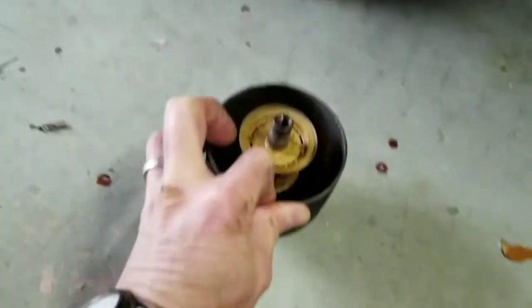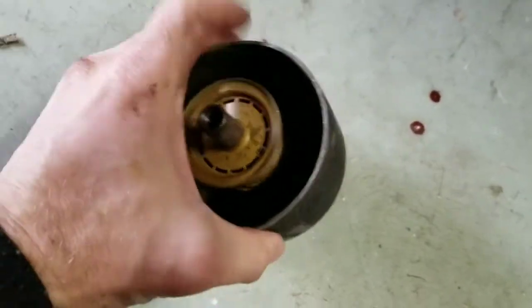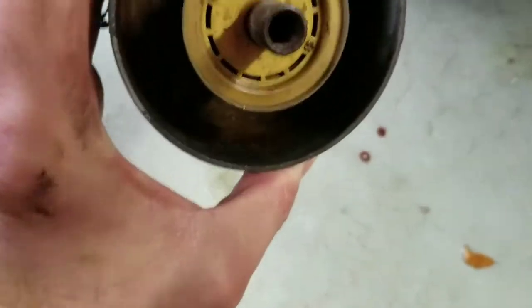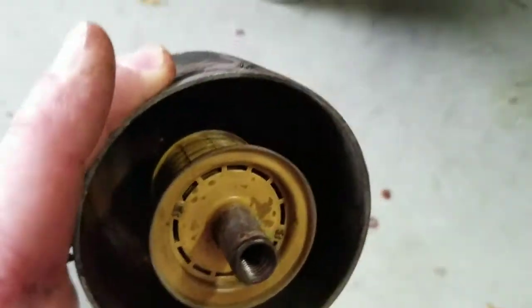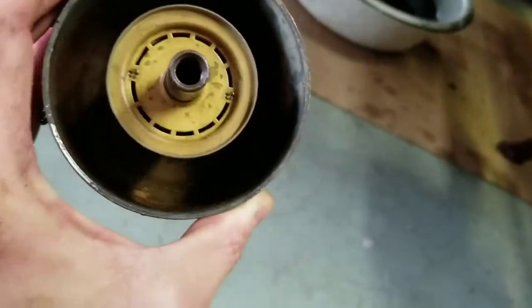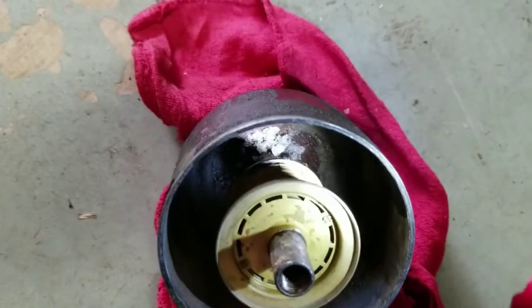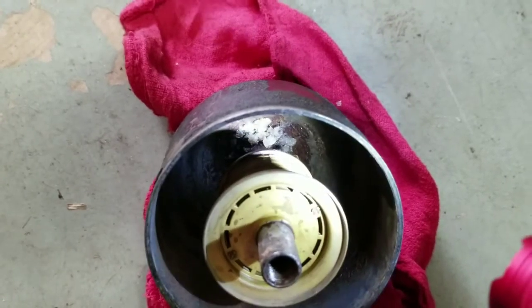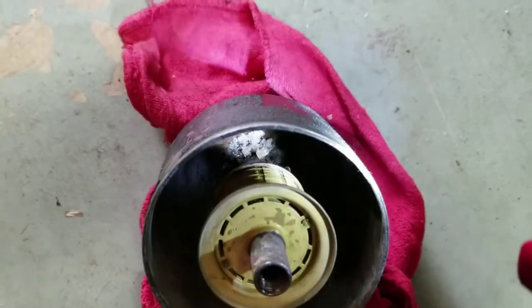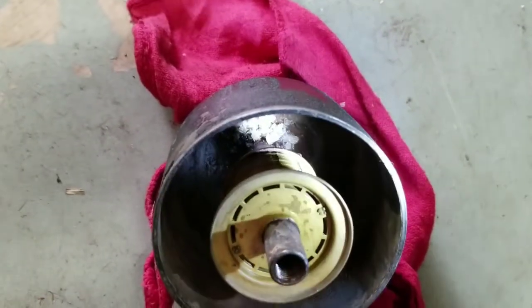In the bowl, let's take a look — this is the original strainer and I can see some particles down in the bottom of the bowl. The ethanol gel is clearly visible in the bottom of the bowl — you can see those white blobs? That is ethanol gel.